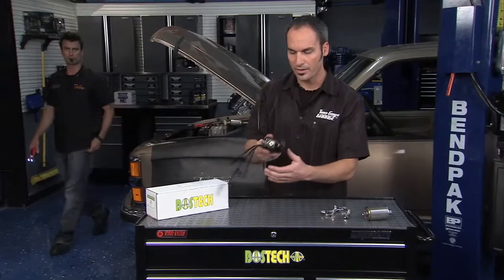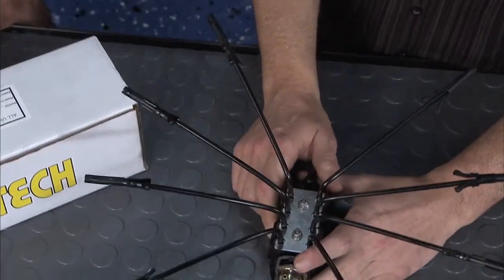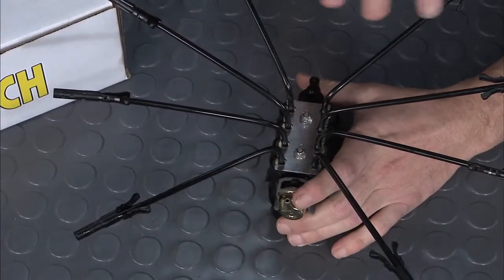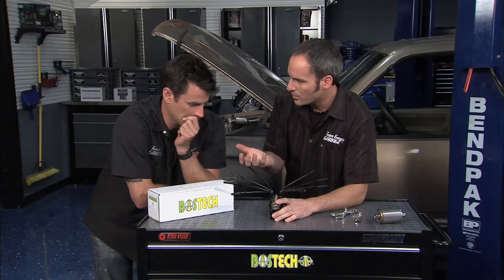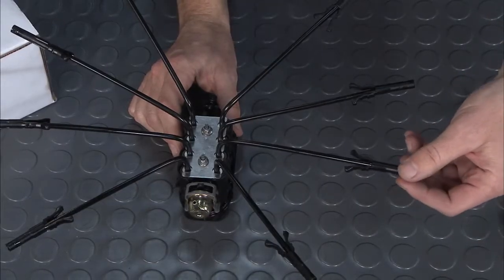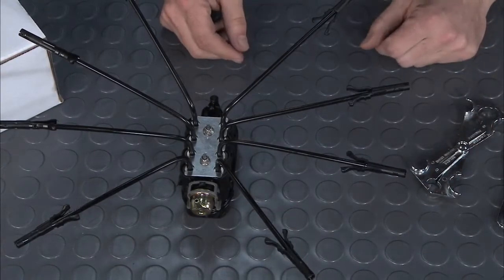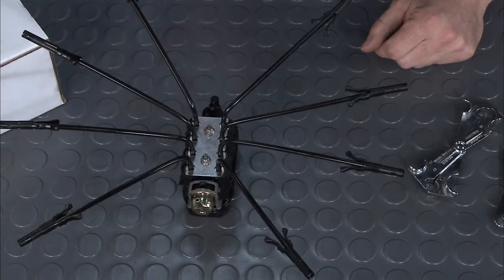This unit fits up underneath the intake manifold — you can see the fuel in and out and the regulator as mentioned. Some of the things you want to check to figure out if you need to replace injectors are things like rough idle. Once you've eliminated that it's your electrical system — spark plugs, wires, and coils — you can look at things like fuel trim. One of these might be a little bit clogged or sticking, and all of a sudden this bank is going to be running richer because your O2 sensor is going to try to compensate. So you're throwing extra fuel through the engine out the tailpipe, which costs a lot of dollars. There's a lot of fuel economy that can be picked up by maintaining your system all the way up to the injector side.